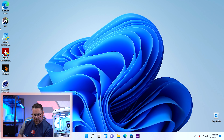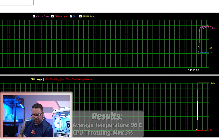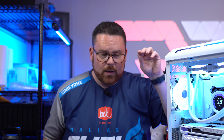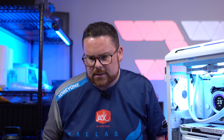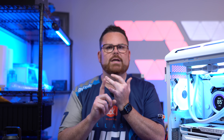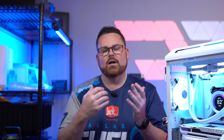Starting up Aida64 — fans are running noticeably higher right now. I'm going to test this running with max fans just to see what we end up with. So everything is on a fan curve at max. We're not getting any thermal throttling now — just a 1% blip. We've improved things just with changing the mount, which was super important. We didn't see much improvement from the washer mod, and we've now changed the fan curve. Let's see what we can do with a slight undervolt.